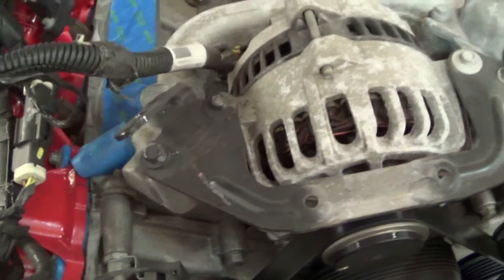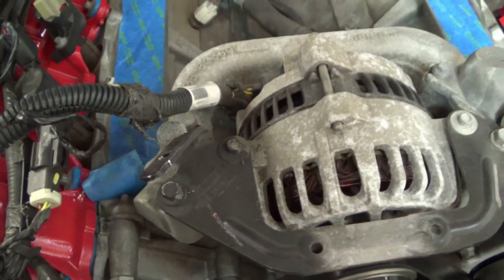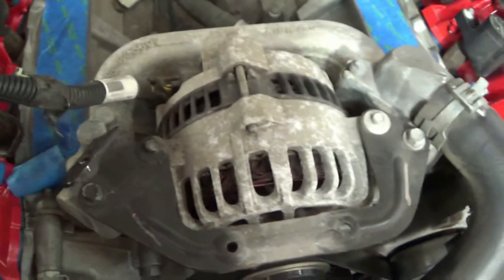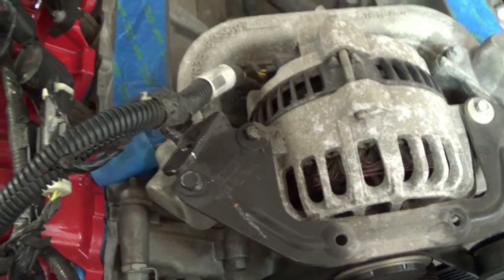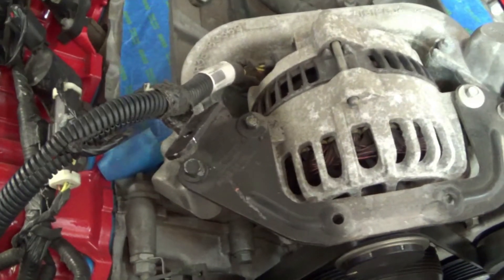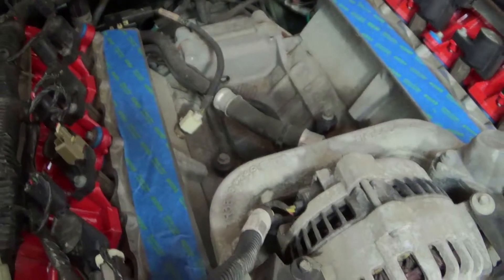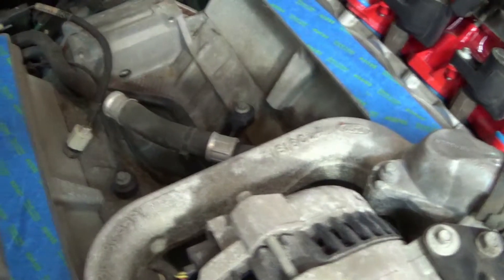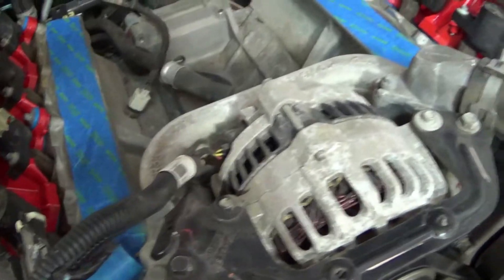The Ford instructions tell you to take the alternator bracket off and bend it forward at 45 degrees, and they want you to drill the rear hole out to a quarter inch. I couldn't see any reason for taking it off - on this particular car as I said, the wire holder has broken anyway, so I'm just going to zip tie that. When I changed the cams I had taken all this apart and cleaned everything, so there wasn't a whole lot of crap down in there. The bracket is modified and I think we're ready to go on with the manifold.